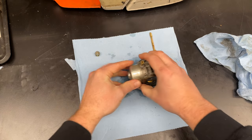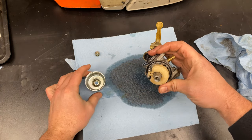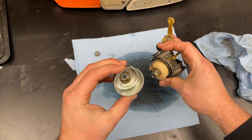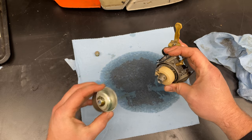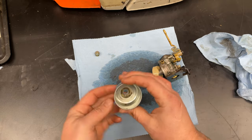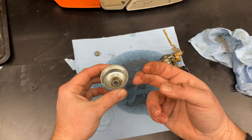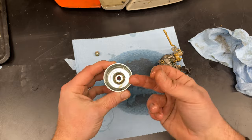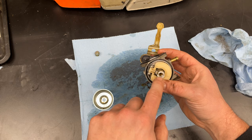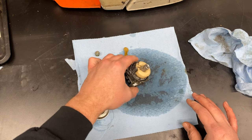Don't lose the brass crush washer. Full of fuel. Maybe this has something to do with it — see all this sediment at the bottom? Or rust or whatever? Look at this — it's dirt. This is dirty. Any of these little pieces of particles or whatever that can block the jet — that's a problem. Let's get a dry towel and then take this apart a little bit further.